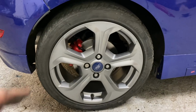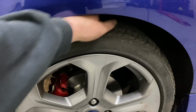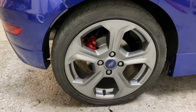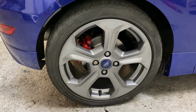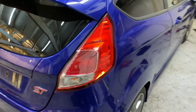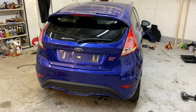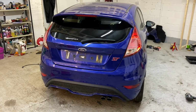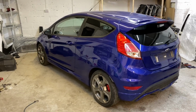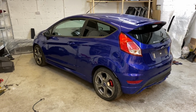But yeah, we'll see. I've still got to change the front tyres as well. Both front tyres are bald, quite close to the limit on the wear indicators on the tread. So they've got to be changed as well, and they're not cheap, I don't think. But at least the discs and the pads are done. It needs a good braking system, especially on this car. It really does. It's quite a high priority of mine to make sure that the braking is good on this car, because it's a quick car, it's fast. Not that I've driven it yet, but I've been told it's fast. Hopefully drive it soon, guys, when it's all done and MOT'd. I'm going to have the tracking done as well, just to make sure the tracking's all right on it. Full MOT. So yeah, there we go.